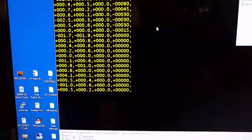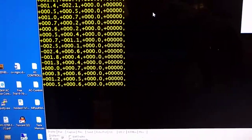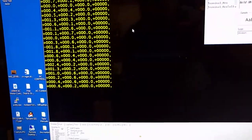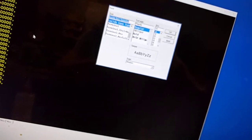Here's a real-time log. We have the direct current, the torque current ID and IQ, the estimated battery current, and the motor RPM. Just focus on the third and fourth channels, which are the battery current and the motor speed in RPM. I'm going to try to twist the throttle with one hand while holding the phone.